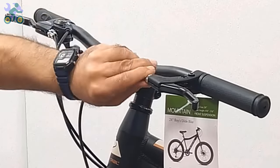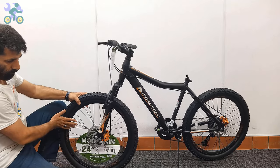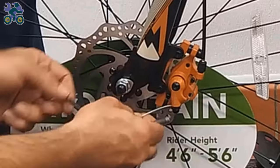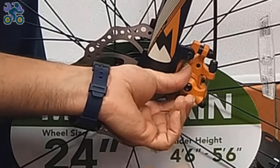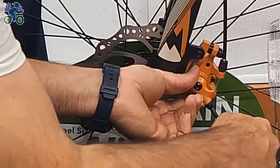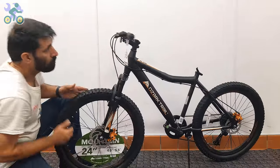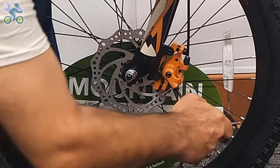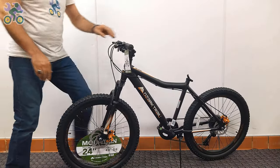Close the adjustable barrel on the brake handle to the end and make sure that the groove of the adjustable barrel is not aligned with the groove of the brake handle so that the brake wire doesn't come out. Loosen the anchor nut of the cable and push the brake arm upward and hold it. Pull the wire to remove any slack and then tighten the cable anchor nut. At the end, put the remaining part of the brake wire to the outside of the rim so that it doesn't make noise when it hits the wheel during movement.